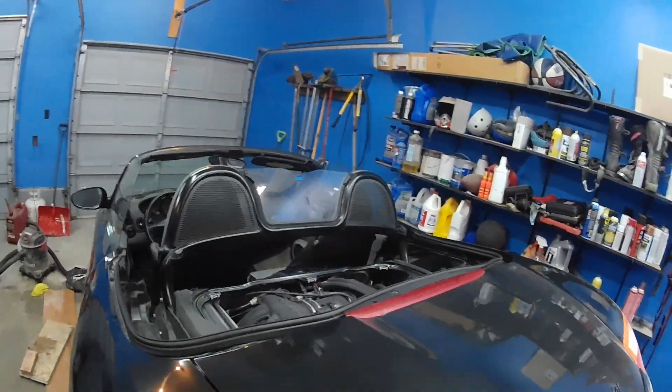I can honestly say I'm very happy with the way the piggyback ECU turned out. I data logged a couple of the runs under full boost and my air fuels are perfect — about 12.5 to 1 down to about 12. I still have a little bit of tuning left to do. The biggest issue now is I'm putting down so much power that the factory clutch can't handle it, so I'm going to upgrade it — a little bit bigger than factory. I think because my car has 50,000 miles on it the clutch is a little worn out, so that's the next step.